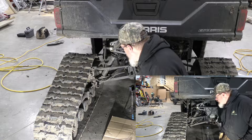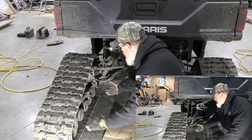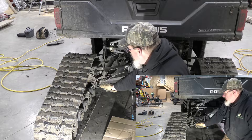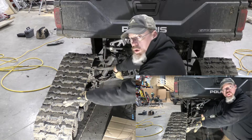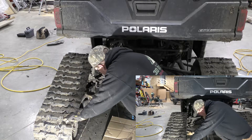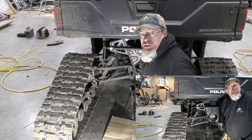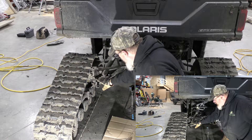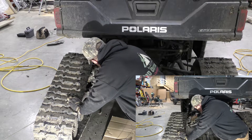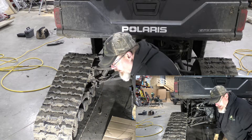We're around to the back side of the UTV now. In this instance, all we have is the bolting to the adjuster, and this adjuster is a toe adjustment which makes sure your tracks are straight on. That was adjusted and set by the dealership when I bought it. We're going to need to take out a through bolt right here — I've got a socket on each side — and there's also a bolt to the shock that's hooked up to it, so we're going to get those taken off.